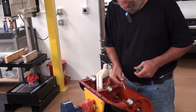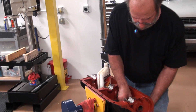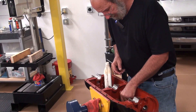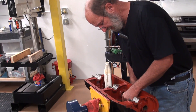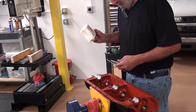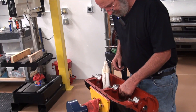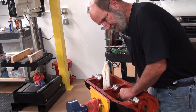We're going to use a two-wrench lifter that seems to be real popular with everybody. Put a little thin coat of oil on them and just drop them down in place. Make sure that they're free, that there's no burrs, that you've got a good ream on it. If you take it to a machine shop, I'd probably just take my lifters with me and let him ream them to size, fit them, and make sure he's happy with them.